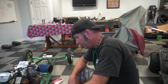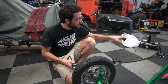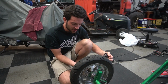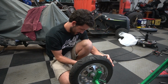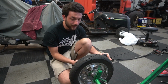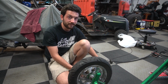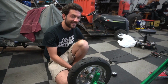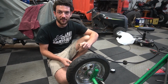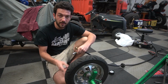So we need to check tire pressures. Yes. So part of our pulling problem could be uneven air pressure among the tires. So I have my tire pressure gauge here. We are at, let's see, like 2 PSI. Probably lost about 5 pounds of that leak you had there for a second. Anyway, there's basically no air in our tires just because it's been sitting for so long. So that could be part of our problem. We have a max of 47 PSI, so I'm going to go 45.